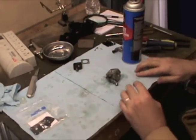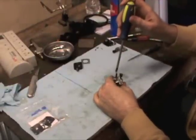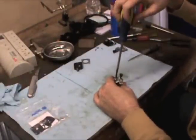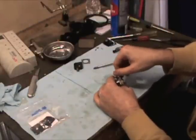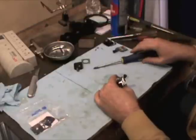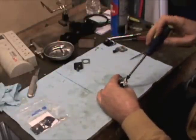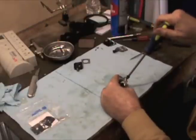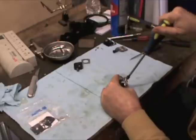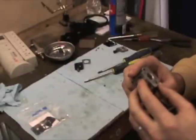One thing on this guys: I counted my turns on these screws here — these adjustments are removable. I just counted the number of threads down till it's seated, then I'm going to count back when I put it back. It's like a half, one, one-and-a-half — it's one and a half turns on that one.